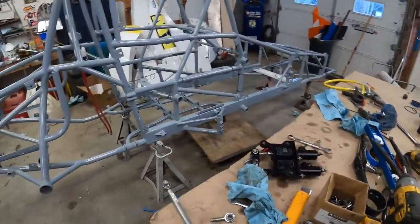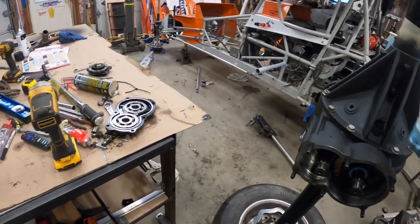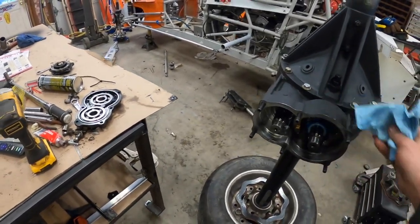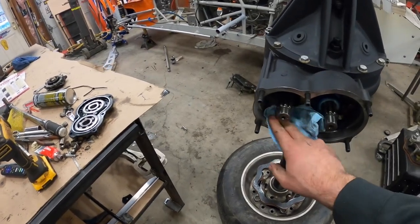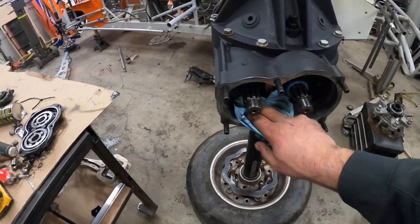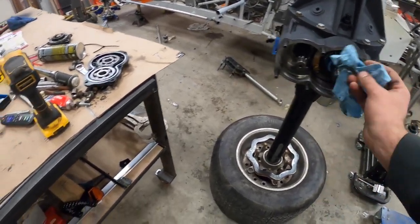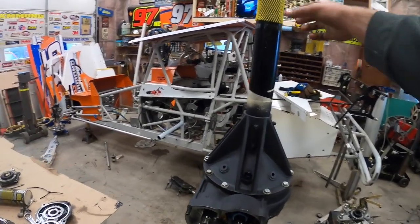And you know, with a dirt car, you change gear a lot more than you do a pavement car, just for handling. If you want a little more giddy up getting up off the corner, you can do that. Where with the pavement, you put the maximum amount of gear in, especially with the crate motors, and leave it because you're looking for the most horsepower and most power to the ground. And the pavement's more consistent. So that's how we work on a quick change rear end.